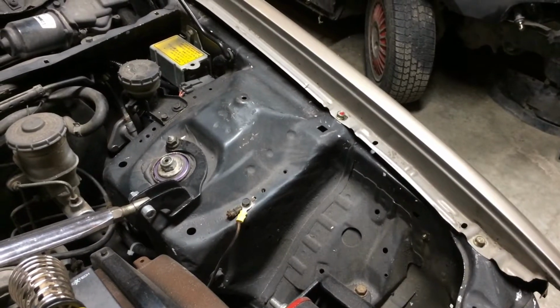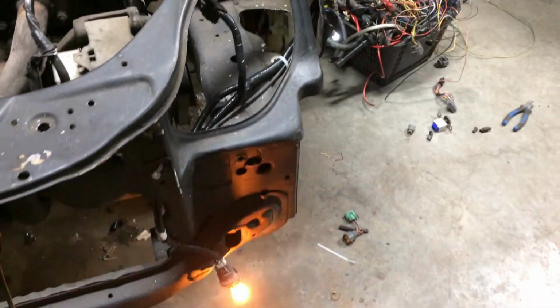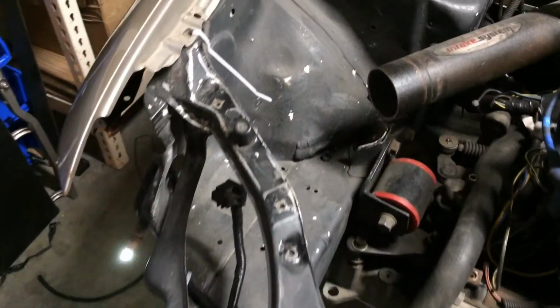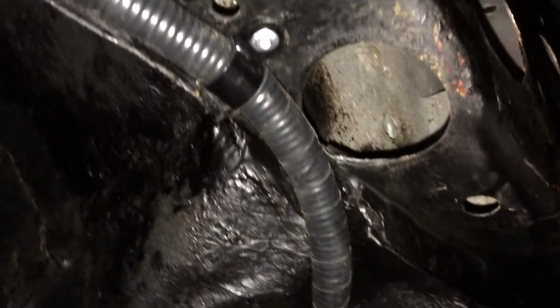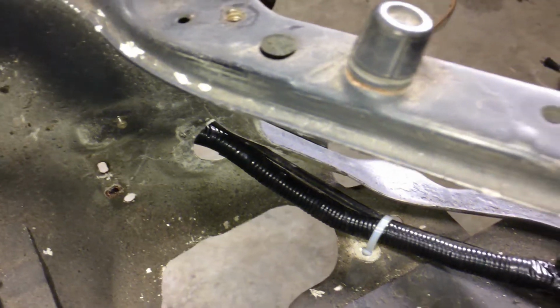And the reason the wiring took me so long to do, like it basically took me all day today just to get through it, was because the Civic only has 2 side markers, or at least this one did. So one on each side for the signal lights, and on the EL bumper I have signal lights there as well. So I had to splice in the EL harness just to make sure that I had all the lights functioning the way that they should. So it was a little bit of trial and error there to get it to work, but got that working.